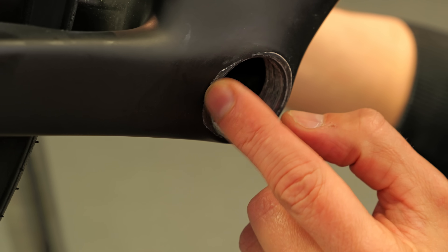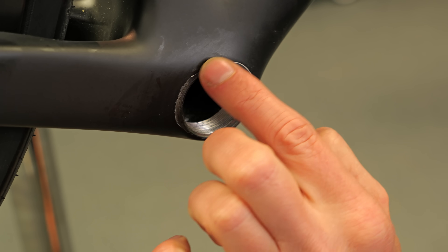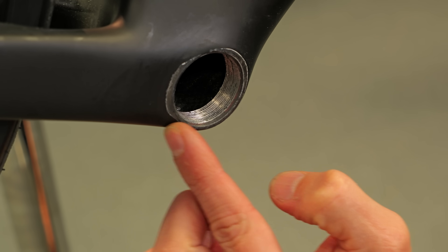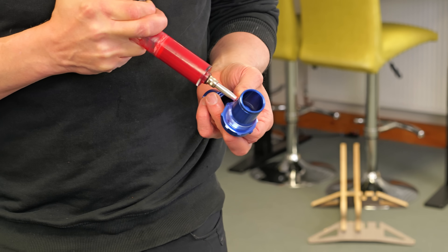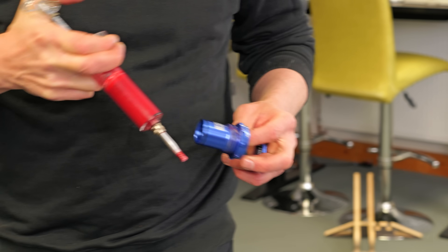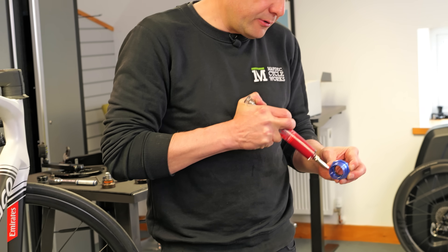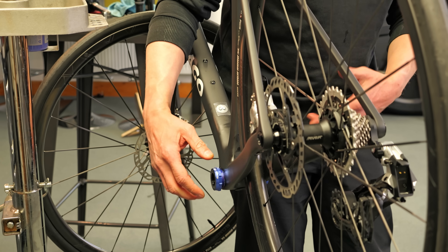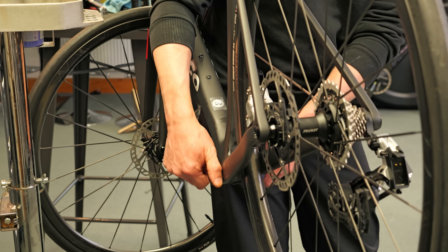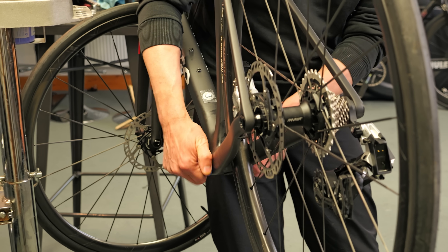You can see these marks now — this is going out to 44mm from here. You can see where the frame isn't actually part of the bottom bracket shell, so you'll never get a good supportive edge from those parts because the frame literally just slopes away. Now, this is construction grease, designed to stop the galling of threads and prevent corrosion — it's not a lubricant. Using a brush like this gets deep into the threads. When fitting these two-piece sections, make sure you don't screw everything in on one side and then the other — screw them in together. Your threads should feel smooth; if not, get them chased, so your torque wrench is measuring tightening torque and not just thread friction.